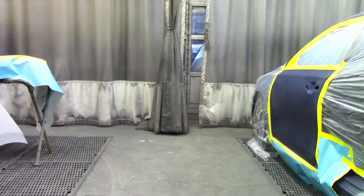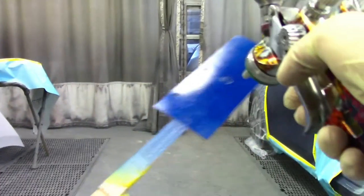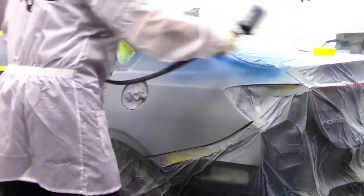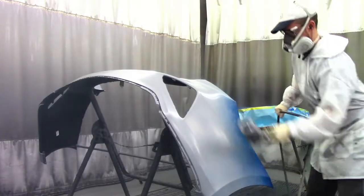What I usually like to do is spray two coats on the panel — spray one coat, blow dry it for about a minute, spray a second coat, and then start covering the car while those two coats dry. Spray the car with two coats down, then come back and spray the two last coats, which makes four coats total. Okay, here we go — two coats. I'm gonna let that dry for a second, go mix my clear up and spray some clear on there.